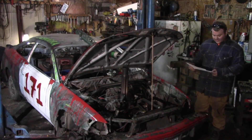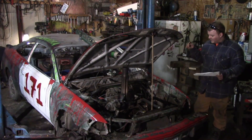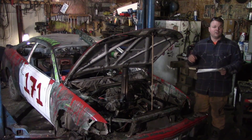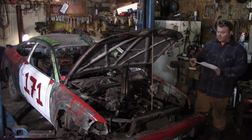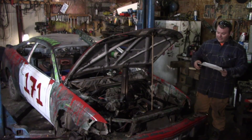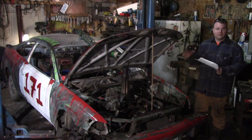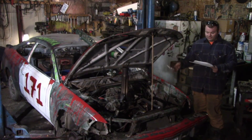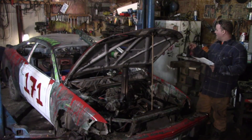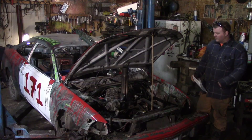I need to put a ratchet strap around the gas tank. Passenger door needs to be tied shut. I need to either swap out the shifter or modify this one just a bit. Rad padding — I want to put a little bit of padding around the radiator. Rear struts wired just so they don't fall out. Check all the fluids because I haven't even checked them. Door padding needs to be tied back to the driver door and chain down some of the motor mounts.